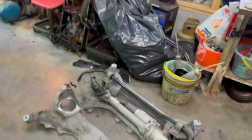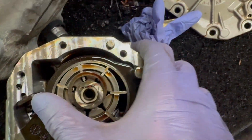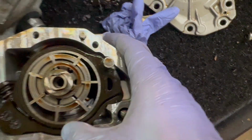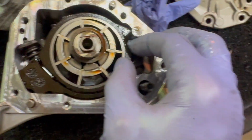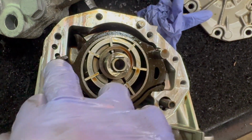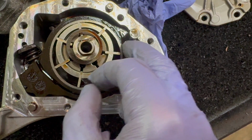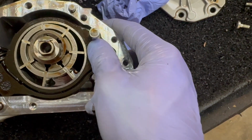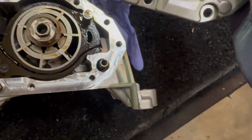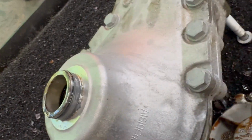As for the old oil pump right here, you can see it is the old style plastic housing. No visible cracks though, actually on the outside here, but I was not able to measure the oil level once the car was hot. But again, there's no visible cracks here. So some are saying maybe the spring over here gets weak and it can't limit the oil pressure, so it goes into high oil pressure. But again, this is the old plastic oil pump. The one on the car now is the full metal one. If I can get the part number, should be, get exactly where it is. And that's never going back together again.